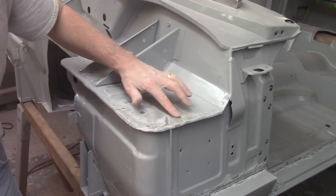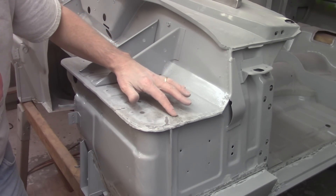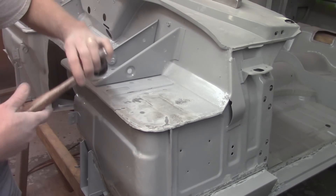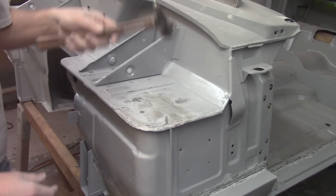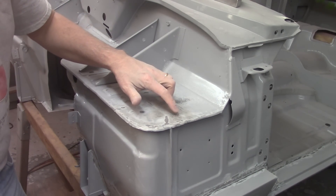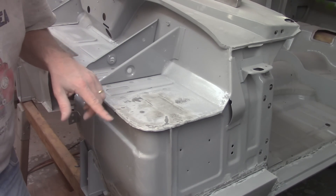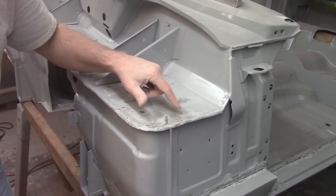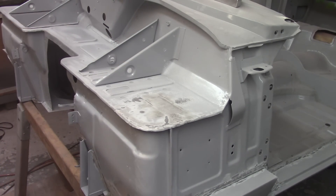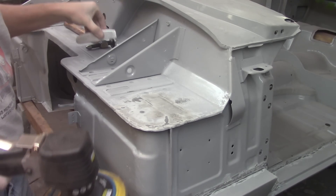So I don't know how well you can see this right here, but this was a huge low spot that I just globbed filler on. I just smacked it up a little bit — I could see the hammer, I used the pointy end, I'm sure that's got a proper name. You could see the blows kind of discoloring the fiberglass — pretty subtle. Now I'm going to take my DA sander and just try to take that stuff right off of there. I don't have a disc on the orbital so I don't want to get a new disc out just for this.